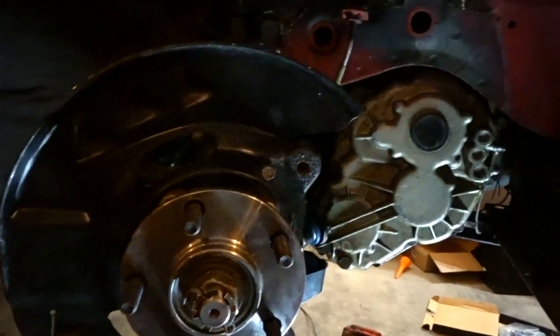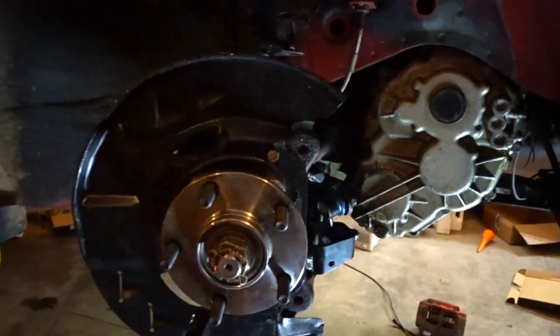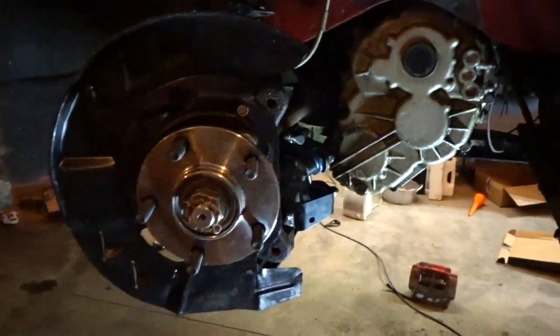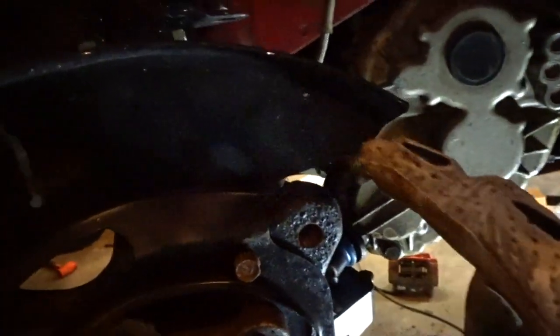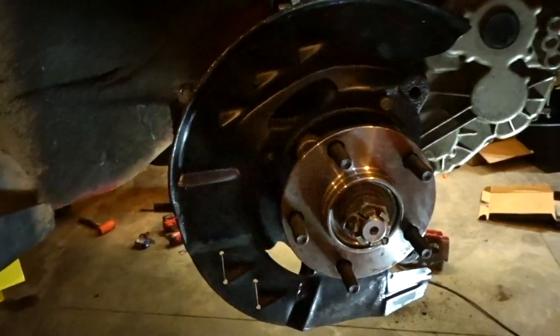Those rotors for the 99 are a fraction bigger — like less than a half inch bigger. Which means all that work I did to make this fit and look pretty again — I don't think I'm going to be able to use my dust shield. I've been sitting here trying to bend it a little bit, but it's still hitting here. You see how I bent this all out? This was a real sharp 90-degree. I don't think I'm going to be able to use it after all that work. That sucks.